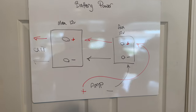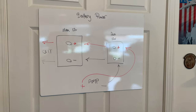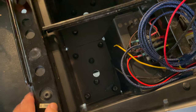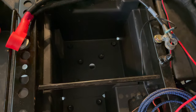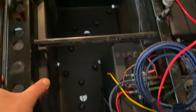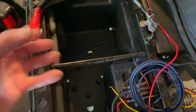Now that we have a really good idea of what we need to make these connections, let's do a dry run of all our equipment and cabling to make sure everything works before we start the install. Here's a quick tip on how to increase the drainage ability for your battery compartments in a Razor: I've drilled additional holes in these battery boxes because the only ones they give you is one here and one here, and that's just not enough to completely drain these battery compartments when you're washing or get water in there. Additionally, I added some grommets that will lift the batteries up approximately a half inch off the bottom of these compartments to allow that water to drain out much easier.